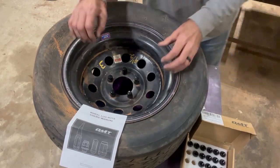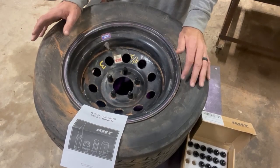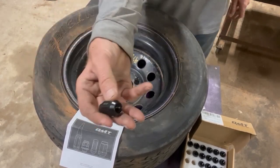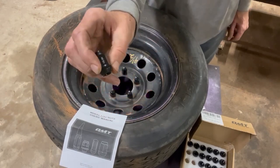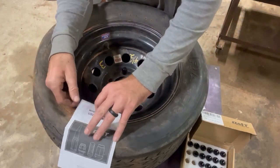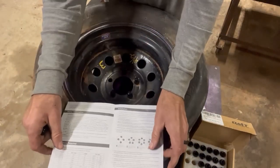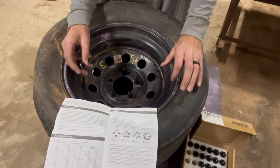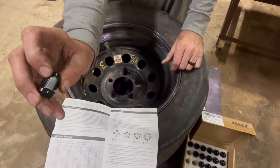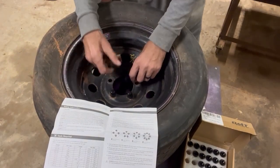Yeah, that'll work. We'll get either a black center cap or paint the hub black — that'll look really nice. I'm glad it was easy to get these; they had them right online. Just look up what size lug you have, and they have explanatory stuff online too. Look up what size lug your specific vehicle comes with and they'll get it on there. This half by 20 is what fit this Ranchero — went right on the studs. So that's perfect. I'm pretty excited about that.